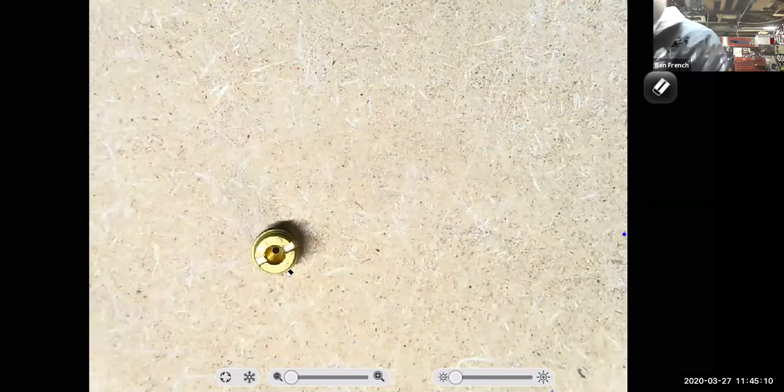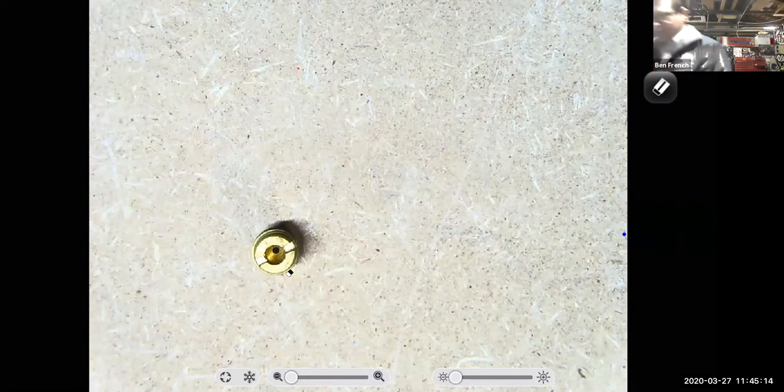All right. Hey, what size is that jet? I don't know. I would use my pin gauge because I can't read what was stamped on there. And like I said, sometimes it will be stamped one thing and it's really something else. So I'm going to grab a 37. 37 fits.